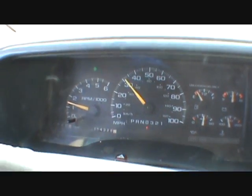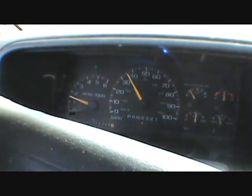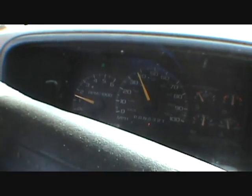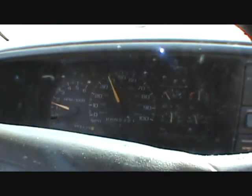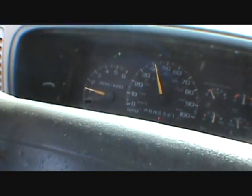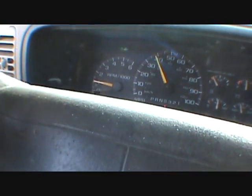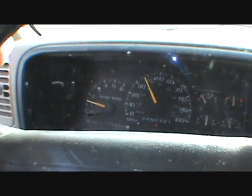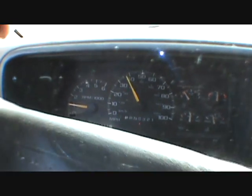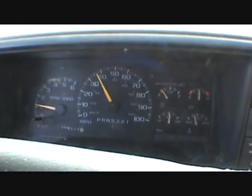I don't know what's going on with the truck. That's all the further I can get it to go. I step on the throttle anymore, it's just like there's no gas. Oh, well. I give it gas and it loses RPM. I know the fuel filter was plugged, but God, I hope it didn't get dirt into the spiders now. If I got it into the spiders, it should be missing like crazy, and it's not.